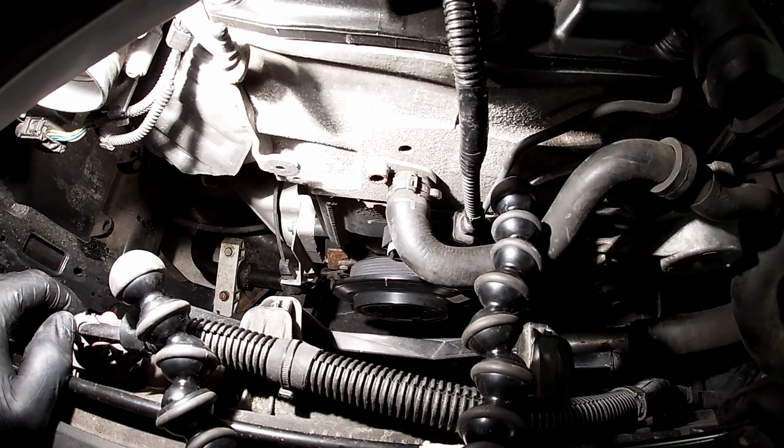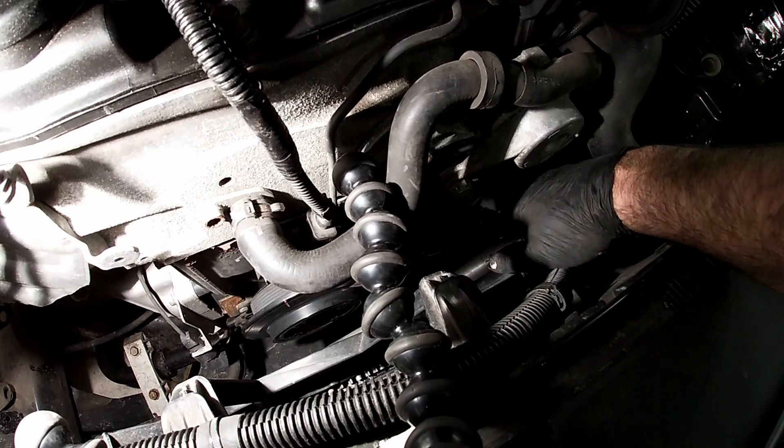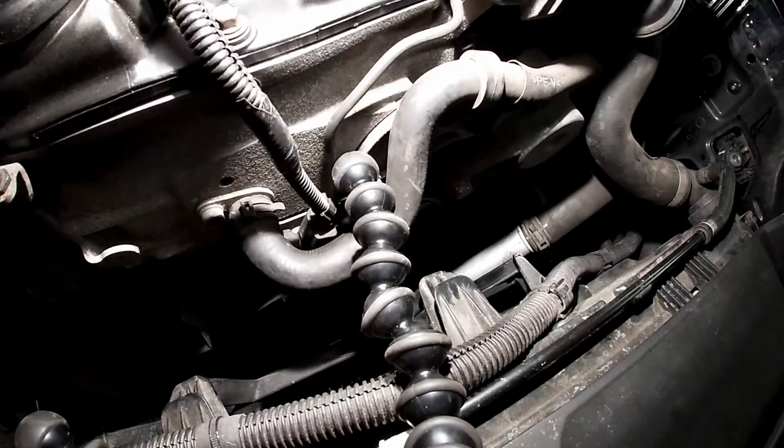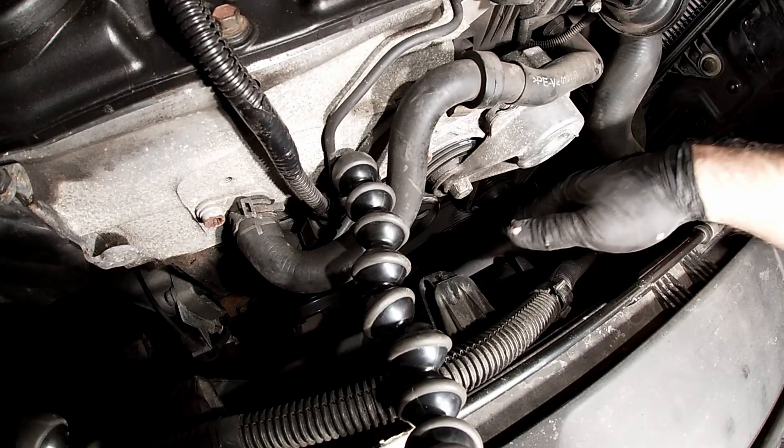The alternator is correct, power steering pump is done, the AC is routed correctly, the alternator is correct, and the tensioner pulley is done. Check how it wraps around the water pump — that's good. Last thing is to make sure it's wrapped around the crank pulley properly. It's got a pretty big lip on one side, so as long as it looks good and you can feel it on both sides coming out, you'll be all set. The belt is on — it's a little bit of a pain, but you have decent access. With seven pulleys to go around, it takes some effort.